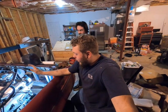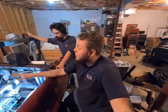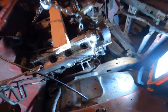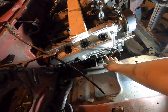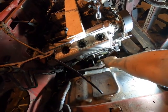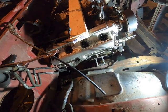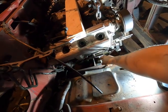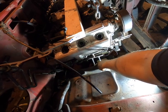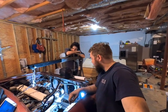We're going to call it for tonight. We've spent a good bit of time and really focused on the passenger side mount — we'll take care of the driver's side tomorrow. So basically we followed what a universal mount would do: we got a solid mount, this is our plate that bolts up like I showed you. Then we've got two runners — this one is a short three-inch piece that comes straight out, and we're eventually going to put a plate here for structural support since it's going to be a high-torque engine. This other runner is about nine inches long and runs down to the frame on the curved side. It's not beautiful, but what do you expect from a couple of shade tree hot rodders?